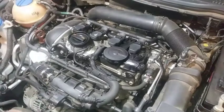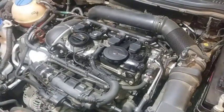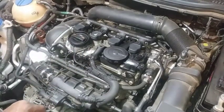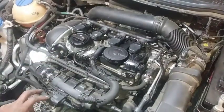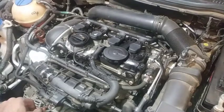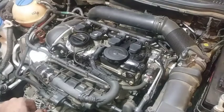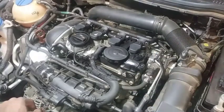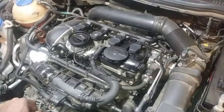With compression comes heat, and this car is not making that much compression, especially since it has misfires and a valve carbon buildup issue. So that's why I put the hotter plug in there to self-clean, and why I changed the PCV system so it wouldn't consume as much oil and overwhelm the plug. I received a little flack on the other videos - I'd appreciate a verbal explanation rather than just a dislike. There's a reason why I do everything, and those hotter plugs are going to work a lot better than the colder plugs.